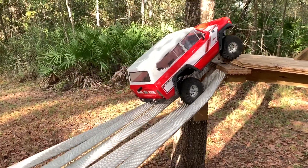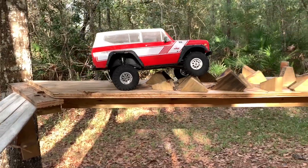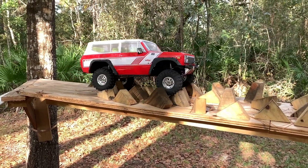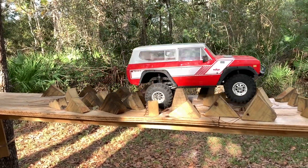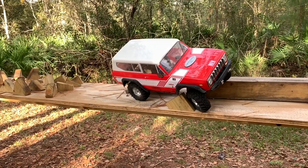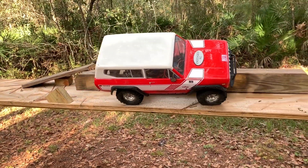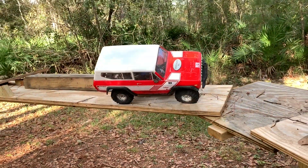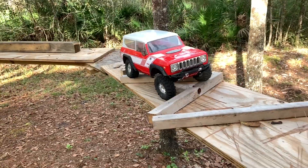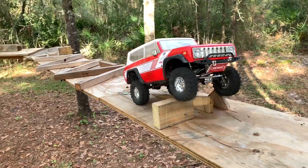To go a little bit further with that, we're going to talk about making brushed motors survive. I recently did a video on this about trying to keep something like a Holmes Hobbies 12 turn motor alive in a crawler. It appears some guys are burning them up quite a bit. In that video, I talked about stalling your motor — you kind of got to drive accordingly. You can stall a brushless motor a little bit better, but they tend to take the abuse a little bit better. Don't stall your brush motor. That pretty much sums it up. Stalling that brush motor just does nothing but cause you problems.